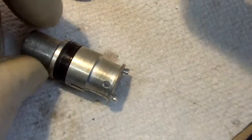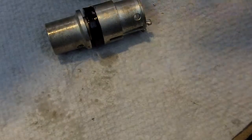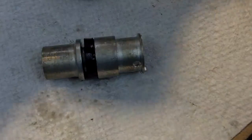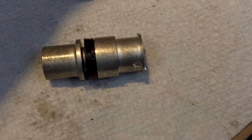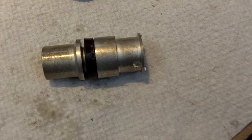You have to push it in, and that's the kind of drag you want on these things. Using the correct brake fluid, which is DOT 3, you get a small percentage of swell — not a great deal, just a very small amount. You can use silicone if you want, but I don't recommend it because these brake units were not designed for silicone. They're from the 1950s and designed for regular DOT 3 brake fluid.